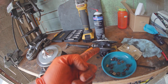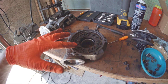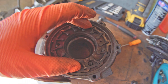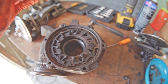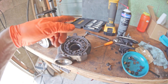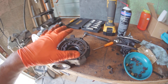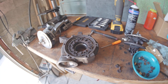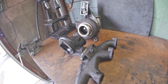Alright, so here's the new turbo cartridge and here's the old one. Here's your unison ring — you can see the vanes moving. When you don't want to make boost or just have it full open, that's this way; when you're trying to spool, that's this way. One thing I've realized is it's pretty dang hard to clock this mechanism — it had a pin and it's supposed to be one way. The way it's set up, the way I use the turbo, it would put the oil feed upside down. Not good. I cut the pin off and now I'm going to try test fitting it a few different ways. And here are the remnants of the old turbo — definitely leaking, just covered in oil.